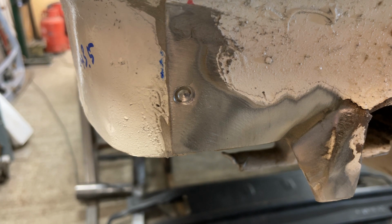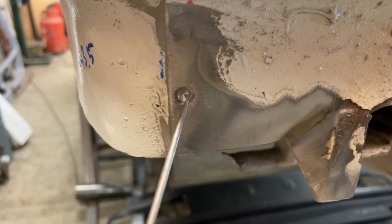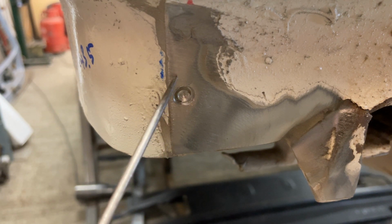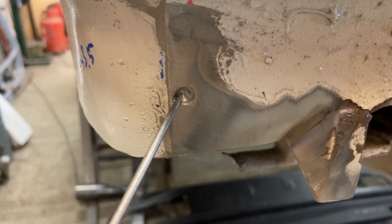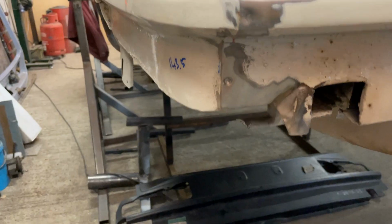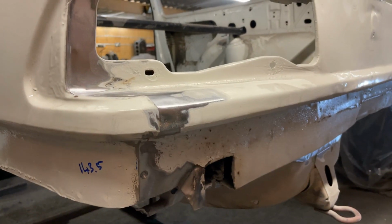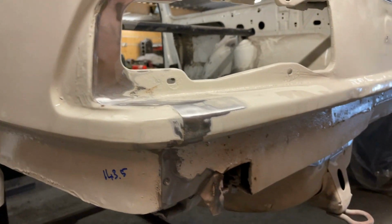Right, so I've brought you right up close, and this is kind of what we want to do. So you see this is still the original back panel, but we've actually torn through it for around three quarters of the way. I mean, that is fine. There is no point in going further than that, otherwise you're just going to end up damaging whatever's behind here. So yeah, hopefully that gives you an idea. There's loads of spot welds all around, so I'm probably just going to try and zip through these.